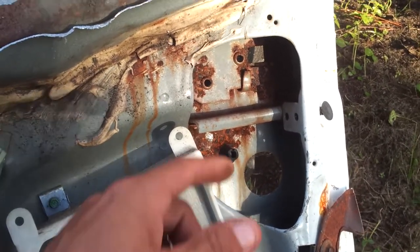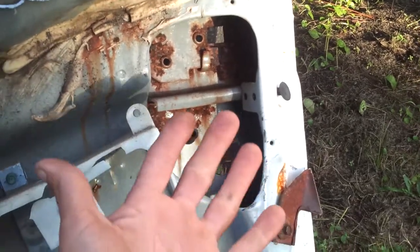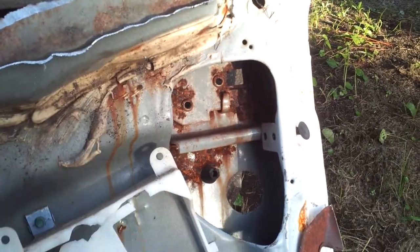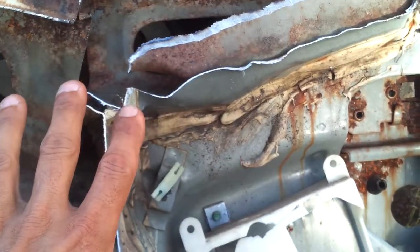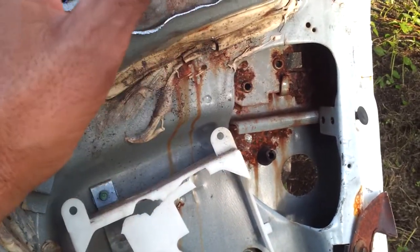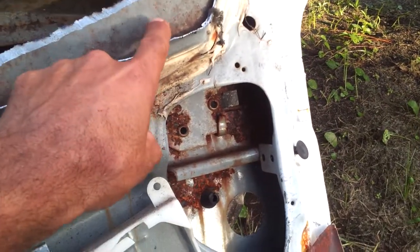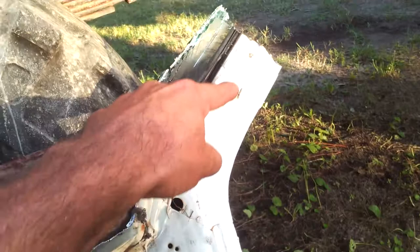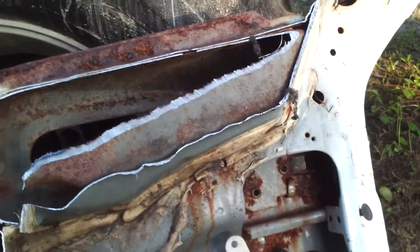On the purple car when I did it, I ended up having to make that top section. So when you're looking for your donor car, make sure you pull that kick panel off and move the computer — whatever you have to do to be able to look up and make sure that section is good. If it's rusted away, there's no point in buying it. They usually go from $100 to $200 for a pair of door posts — I got these at $25 each, plus $125 in labor from the salvage yard, so that's a Florida price. Make sure you look in there with a flashlight, and look at your car too — whether the rust extends all the way up the post so you know how to have them cut it, and whether your actual cowl panel is rusted or not.